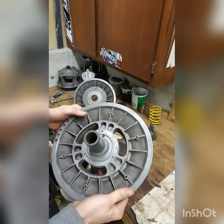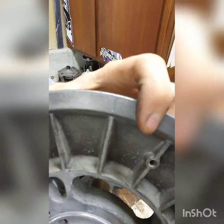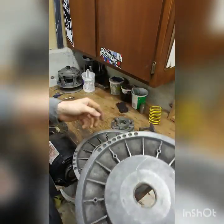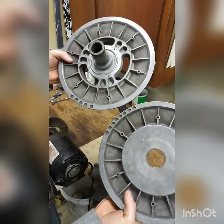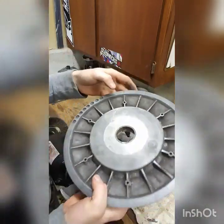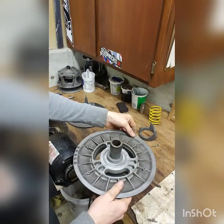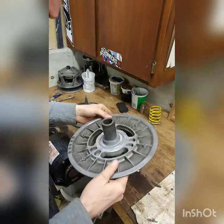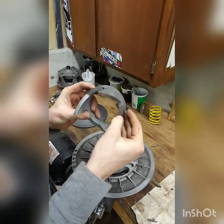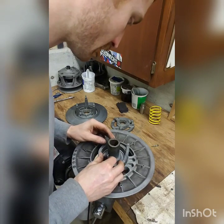Something to note on these old secondary clutches — these Cat roller clutches. You'll see in the sheaves they've got a timing mark cast into them. You'll also notice holes drilled on the outside of the casting; what that is, is they're balancing the clutch. The casting mark is to help you align the sheaves. They put the clutch together and balance it with the sheaves aligned a certain way. Some of the helixes will have a casting mark in them too, some won't — if you've got one, you might as well line it up.